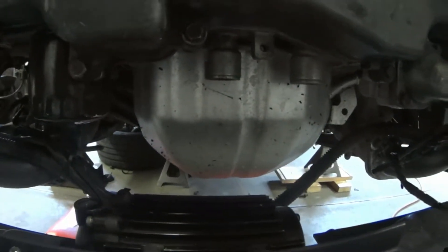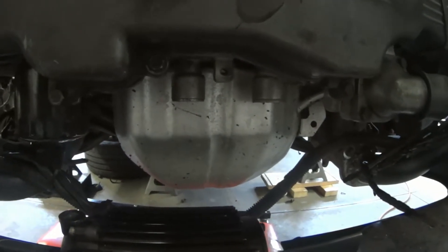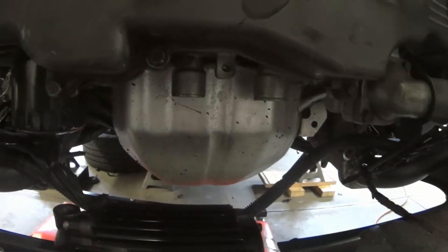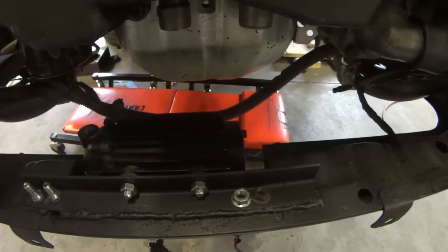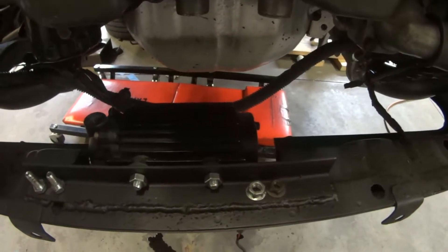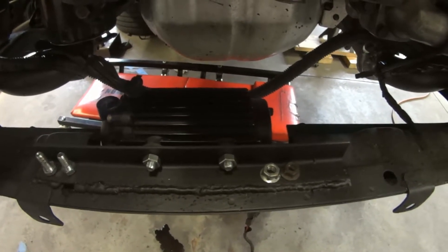What I still need to do is pull the oil pan off and put a fitting on there for the return — that's what I'll be doing. This is actually a pretty decent oil scavenge pump; I will link to it in the video description. So if you find yourself needing to mount your turbos low in your car and you want to make sure your oil drains back properly, I would recommend using an oil scavenge pump similar to what I've done here.